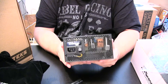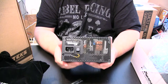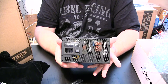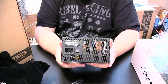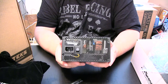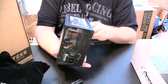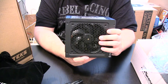Excellent choice for anyone wanting to buy a power supply. For SLI, 860 watts should do for just about any card — of course double-check before you buy. There are various power supply calculators out there; I know Newegg has one, Asus has one. Find one you trust and double-check before you buy a power supply. Make sure you've got enough wattage and, most importantly, check the 12-volt rail — make sure you've got plenty of amperage on that to cover what you need.